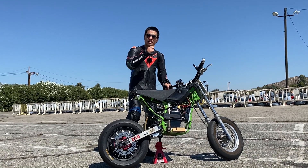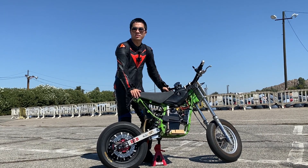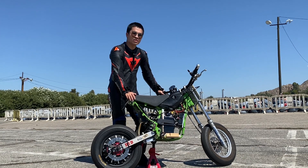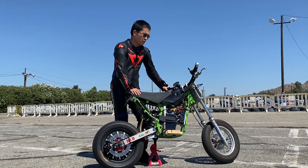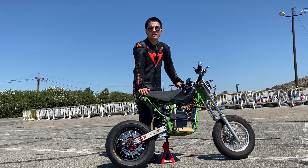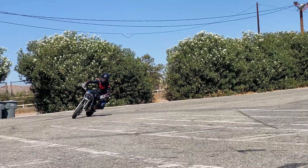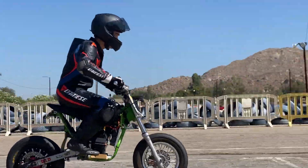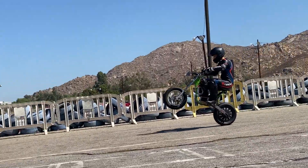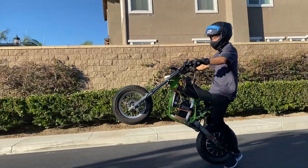The reason I use the KX65 chassis is because this is a tried and true chassis people use for mini motor racing. You can do some pretty economic mods to make the suspension work pretty well for an adult rider. This would work really well for any tight tracks like go-kart tracks or an indoor track, which would be excellent because it doesn't have any emissions — it's electric — and it doesn't have any noise either.